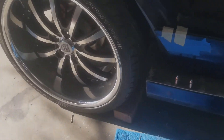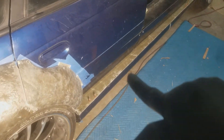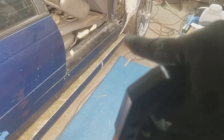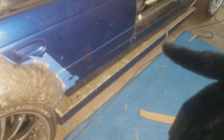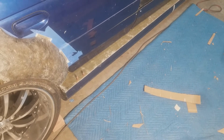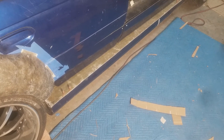It fits right under the overfender in there — that's where that little extra piece is, so it hooks under there and goes right back into the same holes where I had it tested. The back-side side skirt is pretty much finished. I still have to seal between this top layer and the actual skirt — right in between where I had all the cleco pins it's not connected on the sides. I'll put some resin in there to get that seal, and maybe a strip of fiberglass on the inside to connect them.